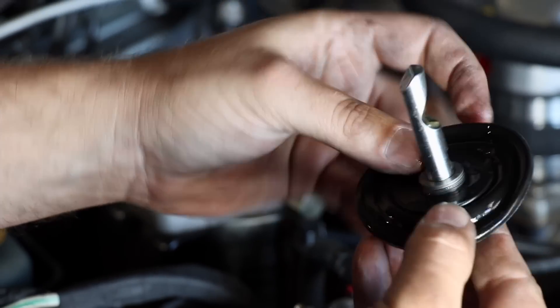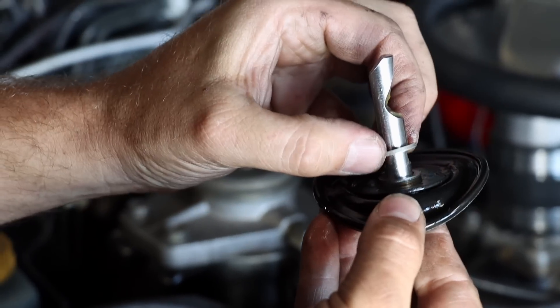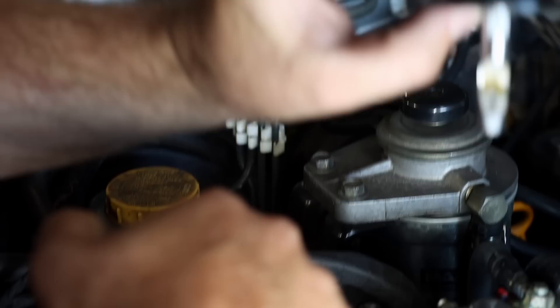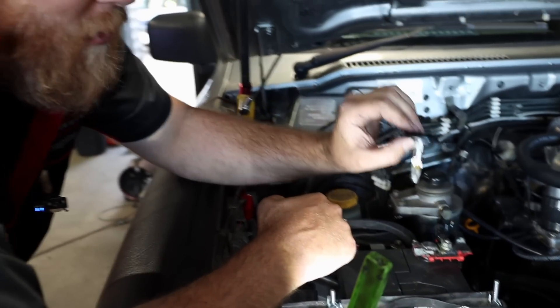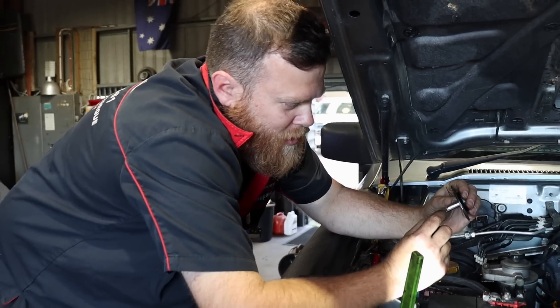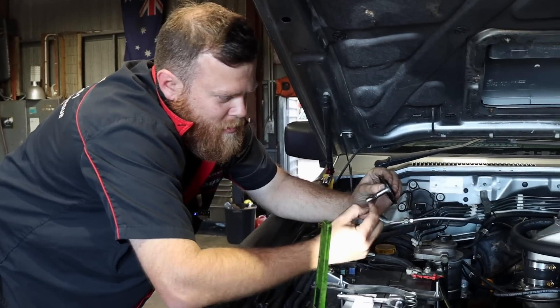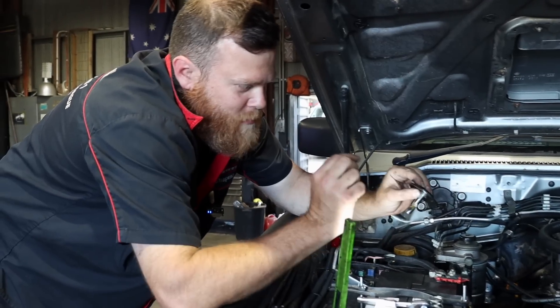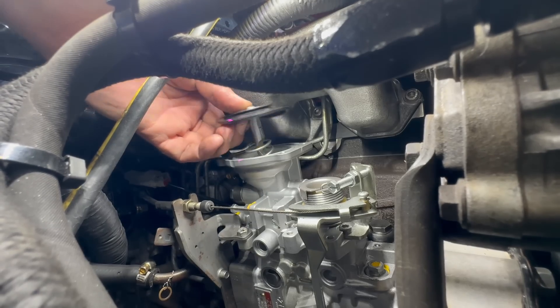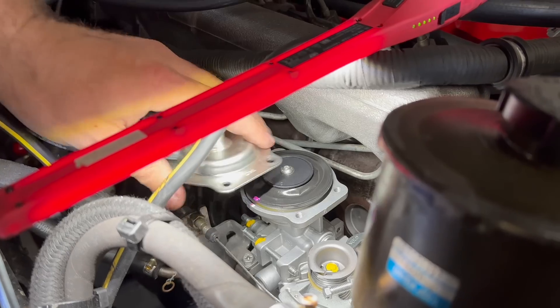We've just pulled the compensator pin out of the pump. These are the shim stacks we were talking about — essentially they limit how far down this compensator pin can travel inside the fuel pump. The further down it travels, we have a kind of eccentric lobe here, so the fuel pin can travel further out — it strokes out more and puts in more fuel. So we'll take a couple of shim stacks out, see if it responds and makes a bit more power, and we'll go again.